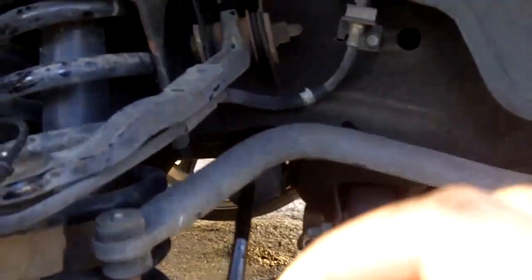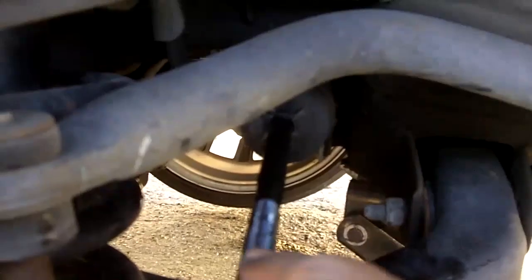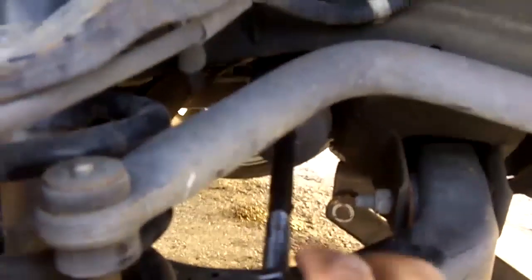Next, you're gonna put that nut back on, which is a lock nut to lock the new tie rod end. Remember how many turns we had? We had about 21 turns on this old tie rod end, but we're putting this new one on. So first, I got to screw this back to make room to get those 21 turns.